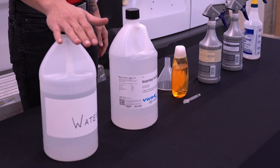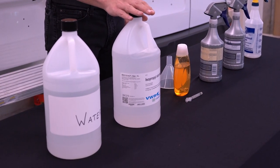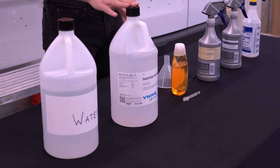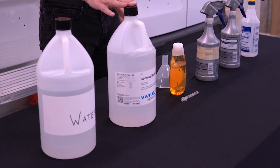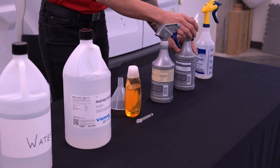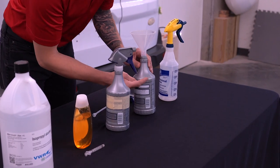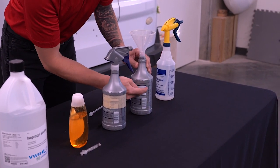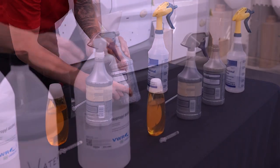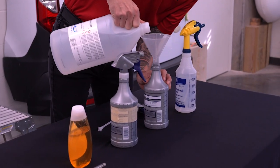This tack solution consists of two ingredients: clean and clear distilled water and either 70% IPA or 99% IPA — in this video we use 99% IPA. Take the top off your 32-ounce spray bottle and insert your funnel into the bottle's opening. Bottles with volume markings on the sides are strongly preferred so that installers can make solutions more easily using the markings as a visual aid. Pour 5 ounces of 99% IPA into your 32-ounce spray bottle.